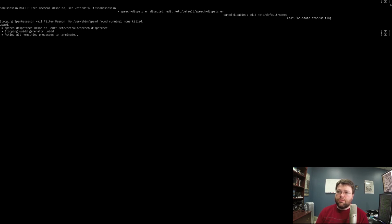To understand secure boot, it's the secure handoff between the UEFI and the operating system with nothing in the middle. So by going through the Windows boot or the Linux bootloader, sometimes Windows will detect that as unsigned or whatever. It's supposed to be signed, and the key is supposed to be trusted, and major distributions are using a signed EFI key to try to get around that.